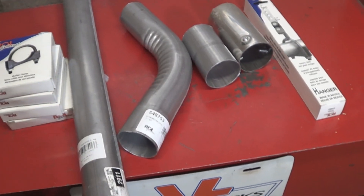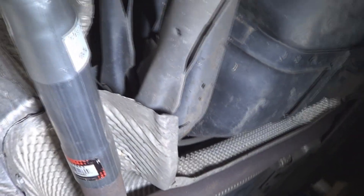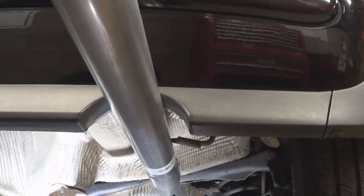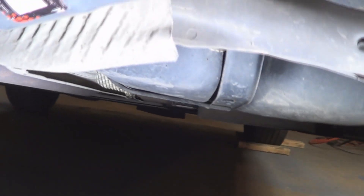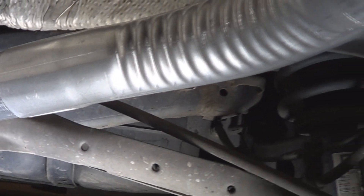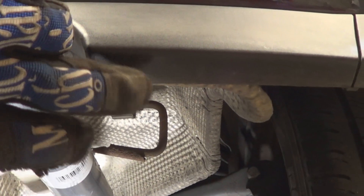Here's what I've got so far. I haven't cut the last piece of pipe yet so I can put the tip on it. I actually lucked out that I had another piece of 2-inch pipe, because the elbow alone was not going to be long enough to make it come out where it should. Here's another part number in case you need it — for an extra piece of pipe to put along with the elbow. I also bent the elbow a little bit more because the way it was, it was going to aim off to the side. So I bent it just a little so it can sit straight.